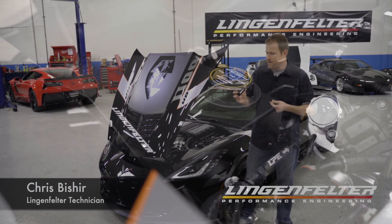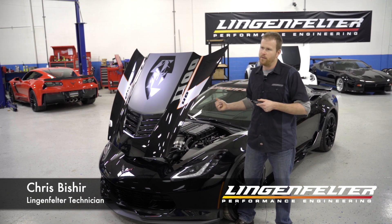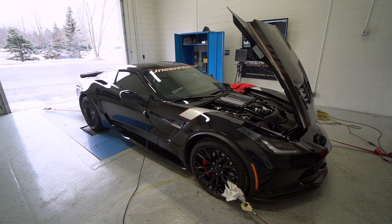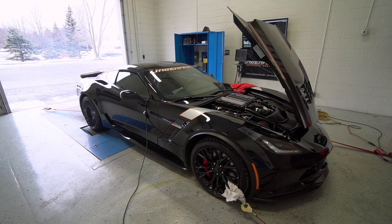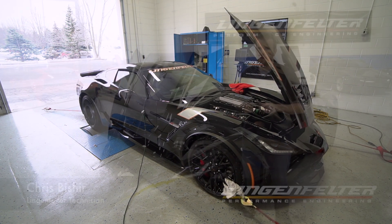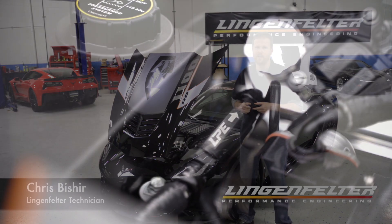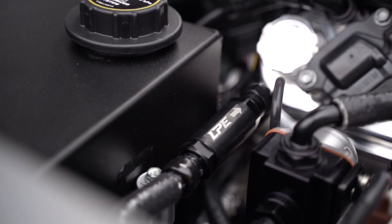The way this came to be is when we started really pushing the boost engines, especially E85, we had a high-side fuel pressure drop. What we found through the logs and the data was that the OEM LT1 and LT4 fuel check valve was actually a restriction at that fuel flow level.